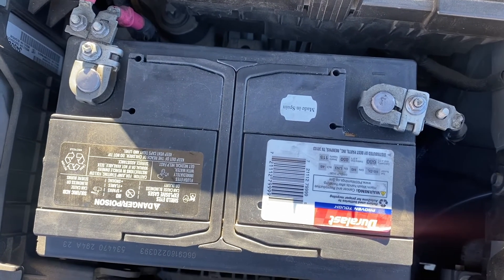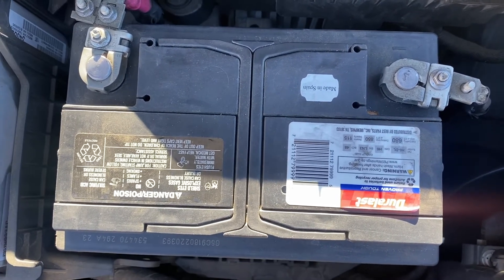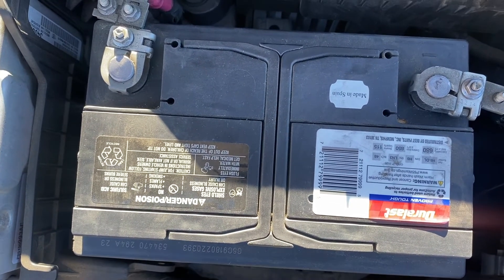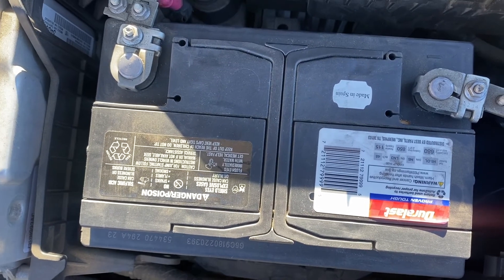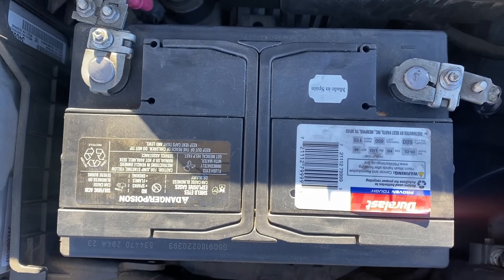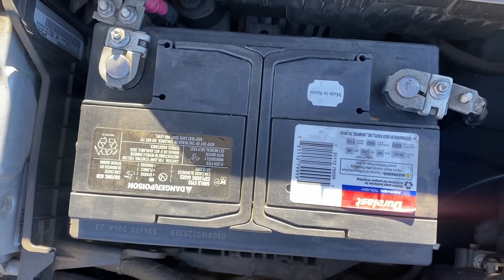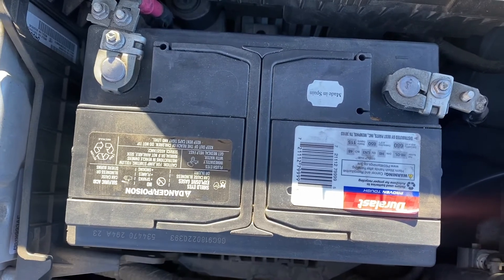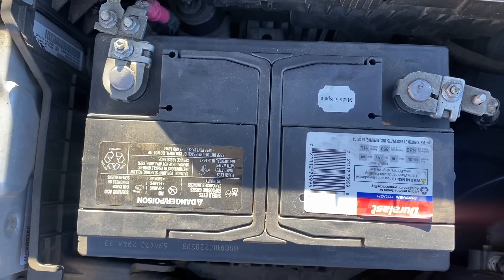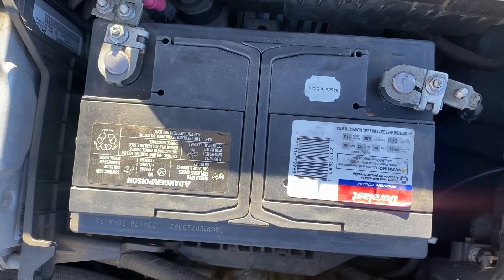A fully charged battery should be between 12.6 to 12.8 volts. Anything over 12.9 volts is considered excessive voltage. And anything under 11.9 volts is considered a completely discharged battery, meaning it's gone bad and you probably need to replace it. If it's under 12.4 volts you still can charge it up, but you don't want it to fall too low. So let's go ahead and check the voltage on this battery before you start the car, because voltage before you start the car is different than when it's running — the alternator will kick in and ramp up the voltage. So let's check it while it's in its flat state.